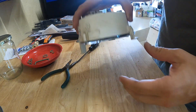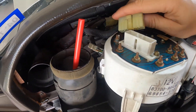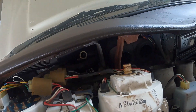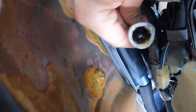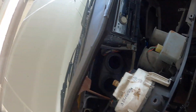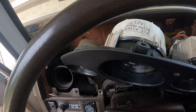We're all reassembled and ready to put it back in the truck. We've installed the three screws and need to hook up our electrical plug. When reinstalling this dash, we've got to connect the speedo cable. If you need some extra room, pull some slack out — you just squeeze this to remove it, and when you push it on it should just snap on. I've removed and reinstalled this several times and it's worked fine. It's got a little groove so it should snap right on. We'll put the dash back in place before putting the screws in and test it out.